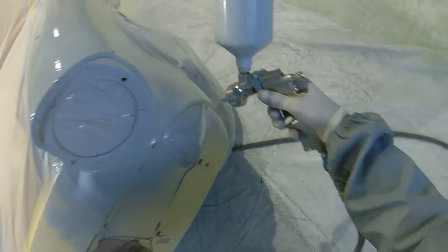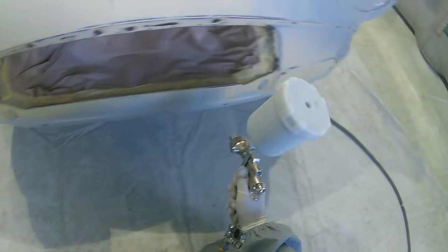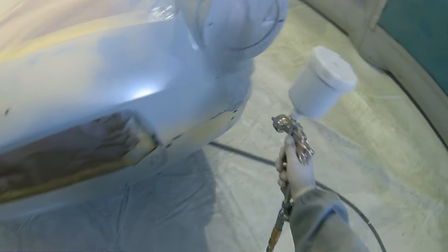And obviously when we do that, there'll be a few little bits of back masking, etc., but we'll go through that again in the next stage, in the next video. So as you can see, I'm taking my time with this. There's no rushing with these coats of primer. We want to make sure we get a real nice, even, wet coat on, nice and thick.